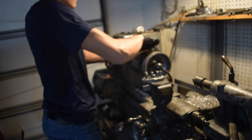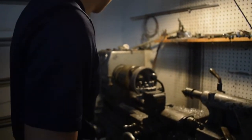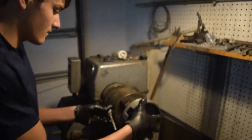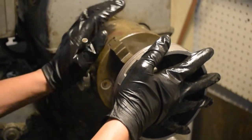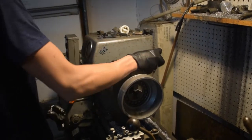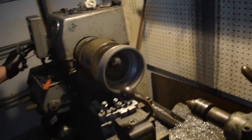Definitely old school way of doing this stuff. We're going to go ahead and shave this down to 1.190. This is to keep harmonics - harmonic resonance - from happening on this. It makes a horrible tone when you're cutting it, it's like a bell. We're at 1.316 now. We want to go to 1.190, so we'll get one more cut here. I'm pretty happy with this - 1.196. Joe's at school at the moment so I thought I would do this part for him.